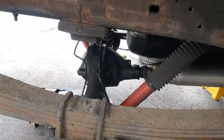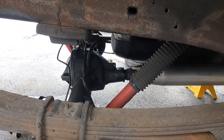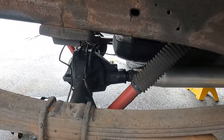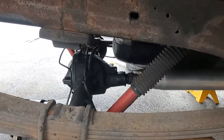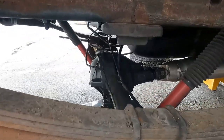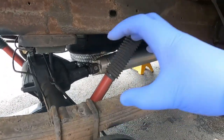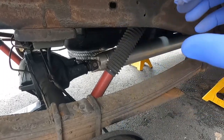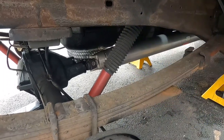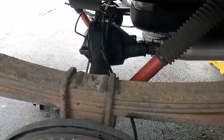The way that I knew that is once I get up to about 70 miles an hour, it kind of shakes a bit, pretty much from 70 on. I get a vibration, more like a pulsing, an in and out pulsation. And the faster I go, the worse it gets. But apparently that's associated with angle. Went to go check my angle, and my angle doesn't work.